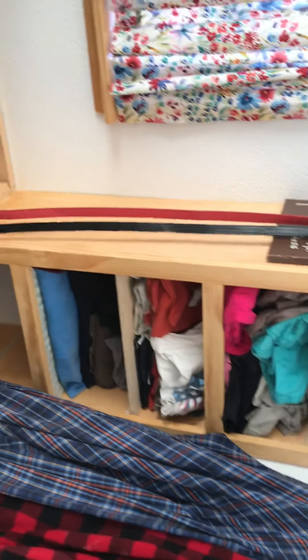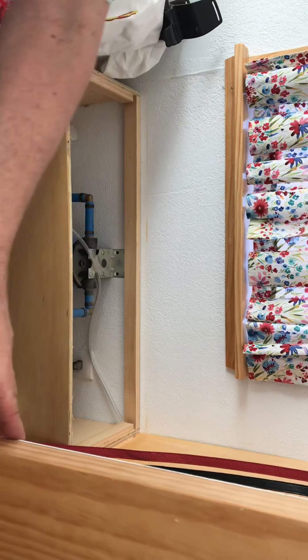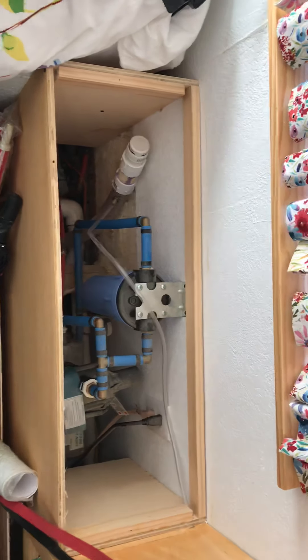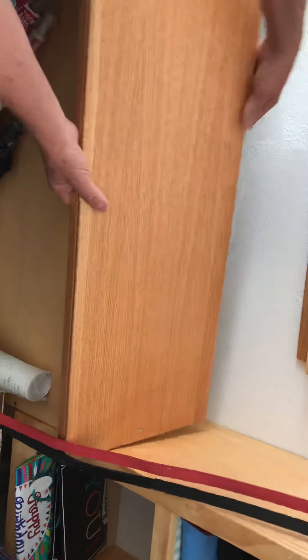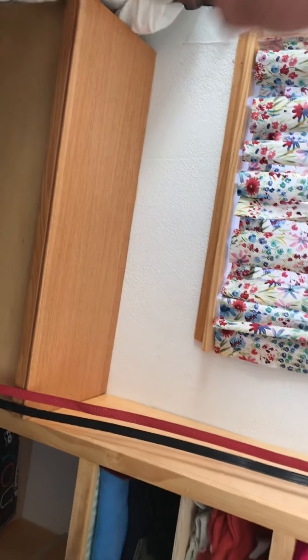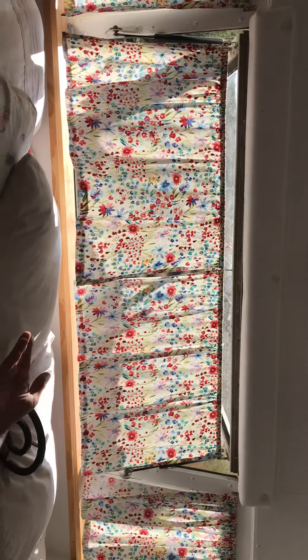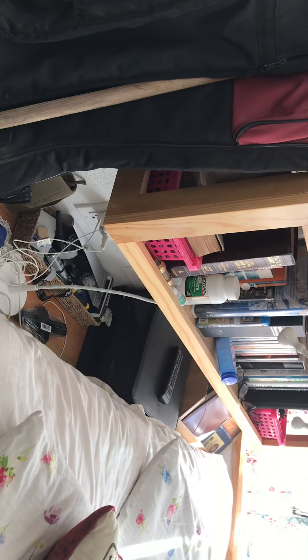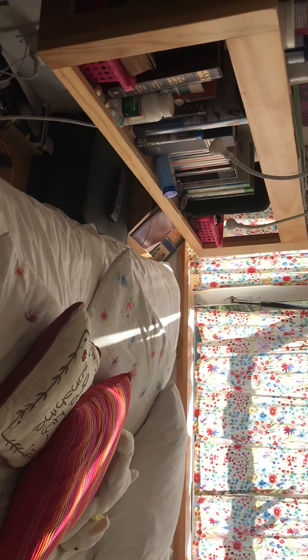Back here in the back, we have a storage area. I don't like the diaphragm-type pumps that buzz, so I put in a centrifugal pump and a four-gallon pressure tank down there. That way we don't have the noise. We love how that back window works — you just open that up at night and open up the vent, and we get a nice breeze through there. I also cut down my air intake on this rear-engine diesel — I didn't restrict any flow, but I made it lower on the side of the bus, and then just covered it with a little bookcase there.